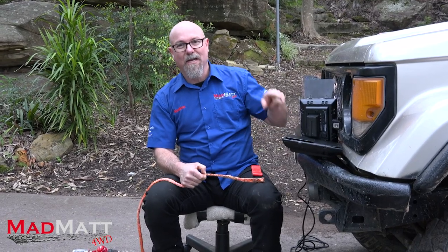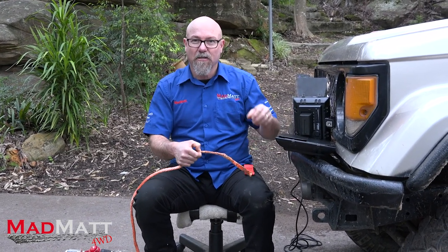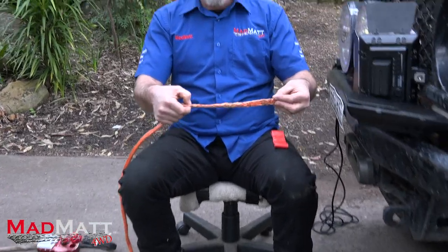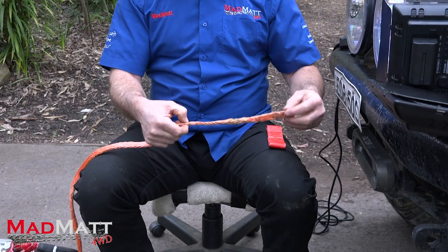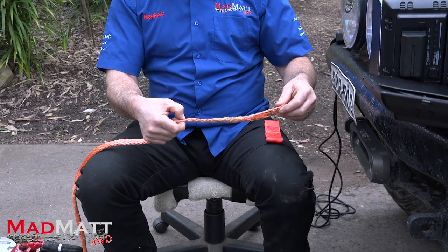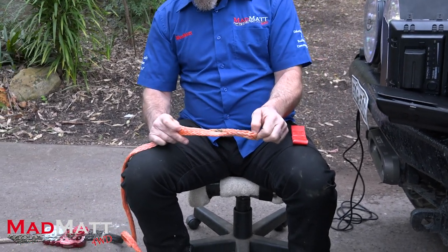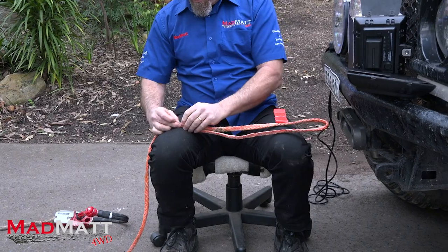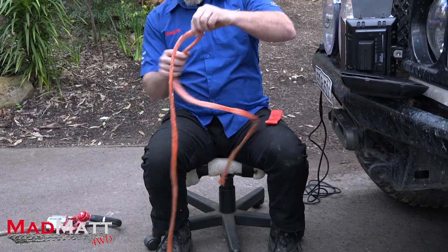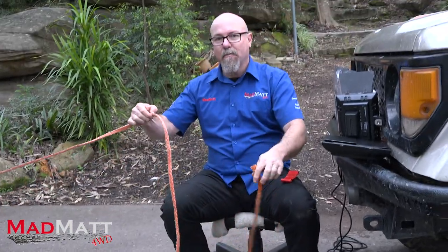For some of you it's probably easier to pull the winch out of the vehicle to do this because it can be so closed and tight — fortunately I don't have to. So that's how much rope I need for one wrap on the drum. To use the plasma lock I'm going to need about eight to ten wraps. I've already done a test and needed eight. So to measure that out: that's one, that's two, two times two gives me four, and double the four gives me my eight. So that's my eight-wrap point.